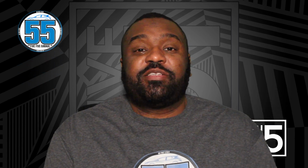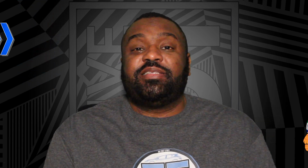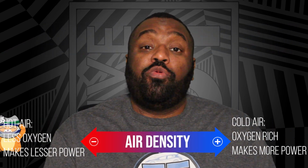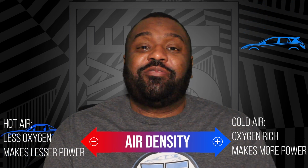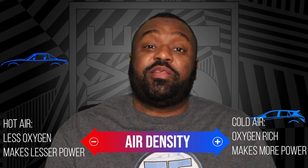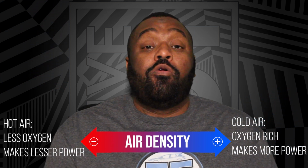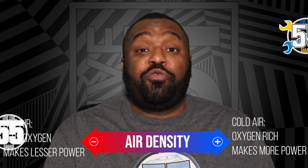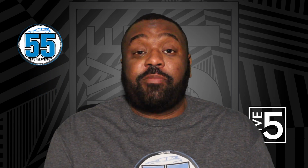Now, when the turbo compresses the air, it gets hot. And hot air isn't the best way to make power because it is less dense. And what I mean by less dense is it does not have a lot of oxygen molecules in it. When you cool the air, you increase the air density, and that means it has the ability to have more oxygen molecules in it. What all that means is the cooler the air, the more fuel you can pack into it, and the more fuel you pack into that air means more power. So the intercooler's job is to basically cool the air that's coming off the turbo so you can pack a lot of fuel into it so you can make a lot of power.